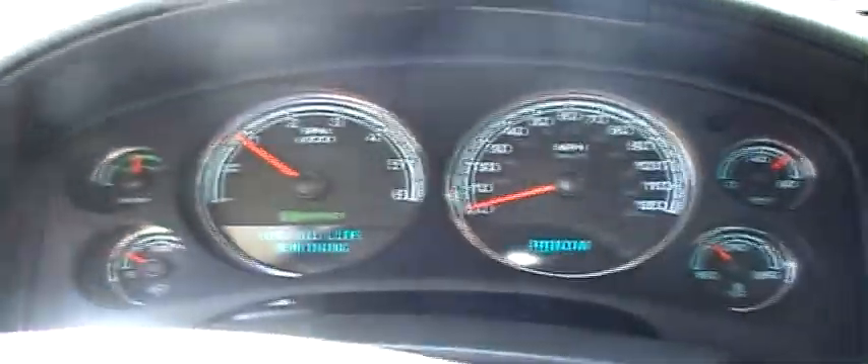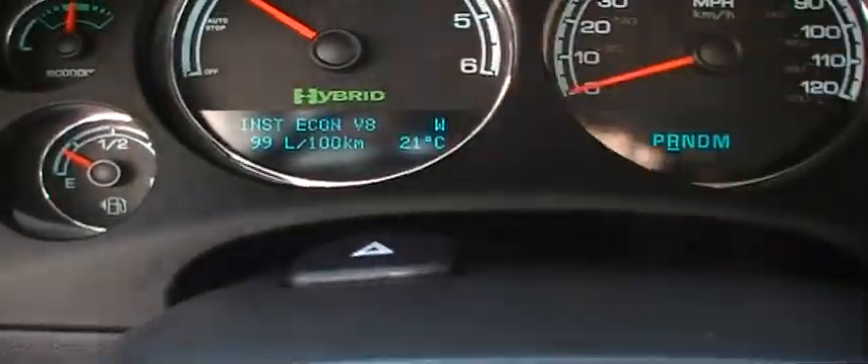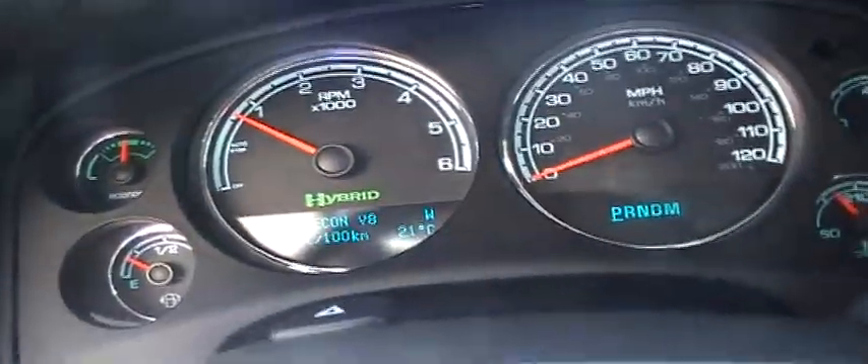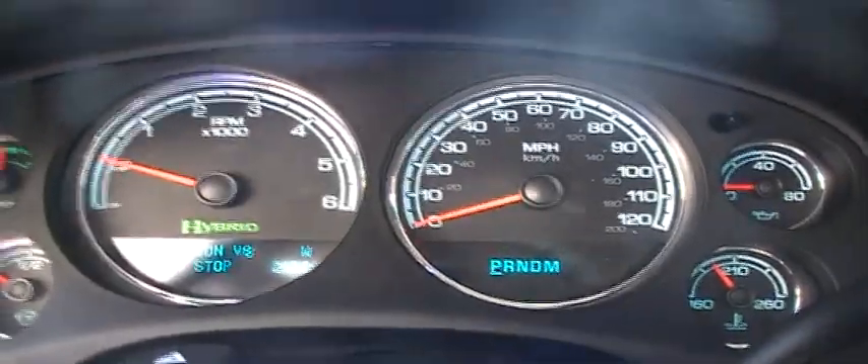Because this vehicle is a hybrid, and all hybrids, the electric motor can't do full assist at highway speeds. Going back to the instant fuel economy, notice how it says V8. This can actually go into V4 mode, which shuts off two cylinders on one bank and two on the other bank — that's GM's multi-displacement system. The hybrid system can only assist at lower speeds, so in order to keep fuel economy up at highway speeds, it shuts off four cylinders and uses half the fuel when it doesn't need to. When the motor's not under serious load, it only runs on four cylinders — that's how you get the highway gas mileage.